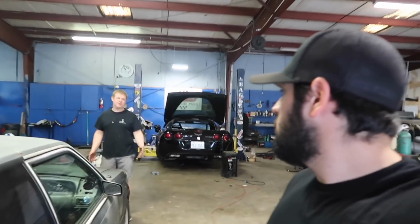Ben, two thumbs up. Everything's good. Perfect. Made 855 at 14 pounds of boost. So that's still lazy on timing. What are we at, like 17, 18 degrees of timing? We should be at like 22, honestly. We could probably be at 21, 22.